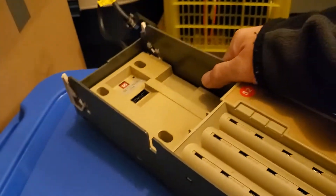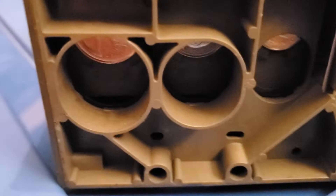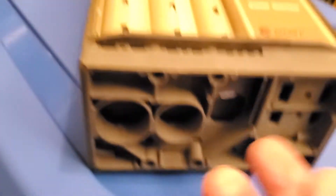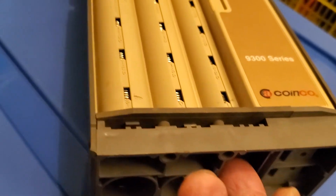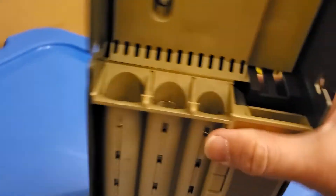Put all the coins on this side or any surface. Then you put all the coins back in. After putting them back, make sure the bottom part is not stuck and everything is aligned. If the coins are not aligned at the bottom it's not going to give change to your customer, so when putting the coins back into your coin mech everything has to be aligned.